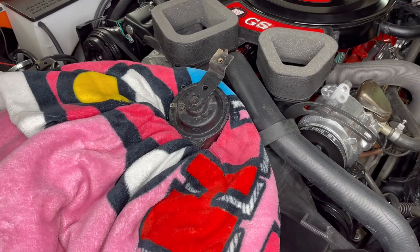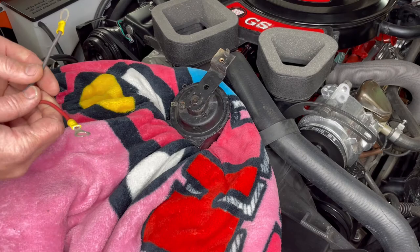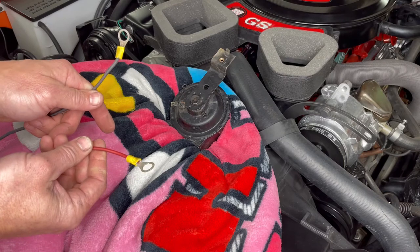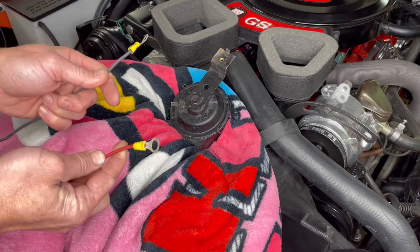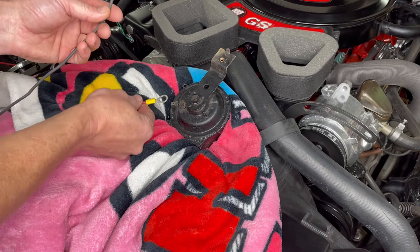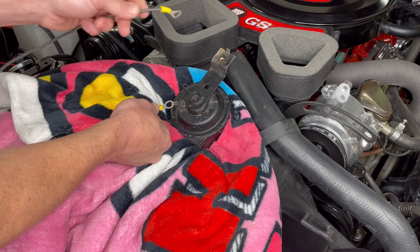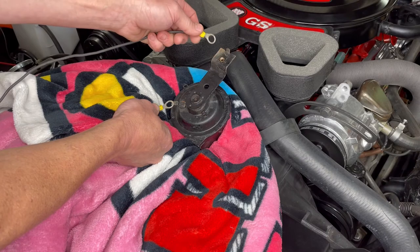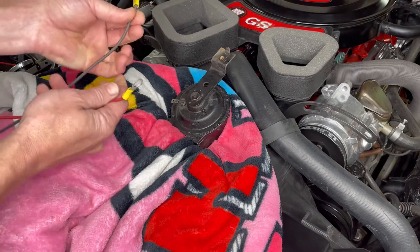Here I've got the horn that needs to be tested. Hello Kitty is making another appearance on camera to help keep this thing from getting scratched. I've got positive and negative coming from the battery — just alligator clipped. I use these a lot for general testing of power motors and stuff, just to make sure they work. Made them a couple years ago; super easy and super handy to have. To test this thing, connect to the hot and find a ground — you might have to sand off a little piece of metal here. Beep, beep, beep — she works!